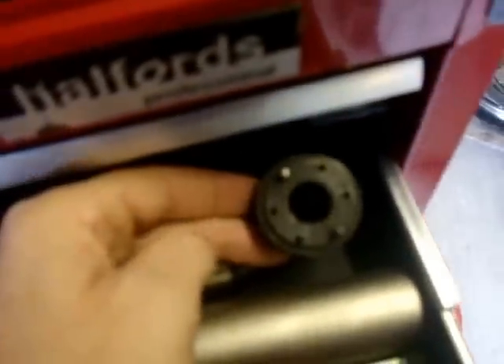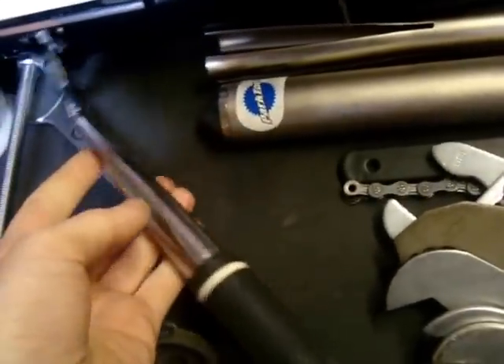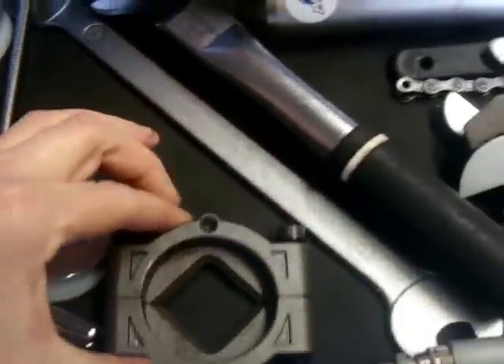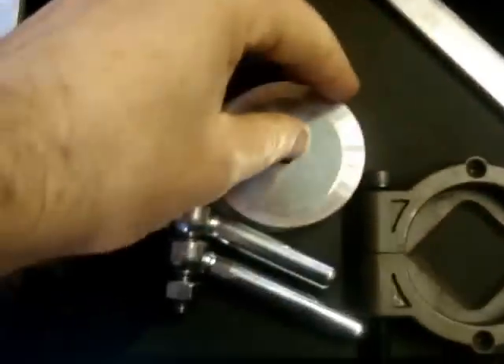Cup remover, and a tool for getting certain things out. I've got my pedal spanners — I've got that one and this one for getting the pedals off. This is a race remover from the crown — you just bolt it on and smack it with a hammer. And my headset cup compressor — puts them on with these spacers here. So that's basically my bikey drawer.